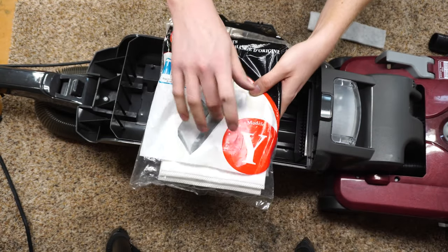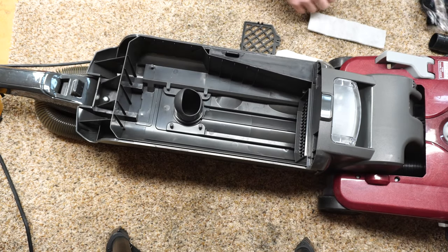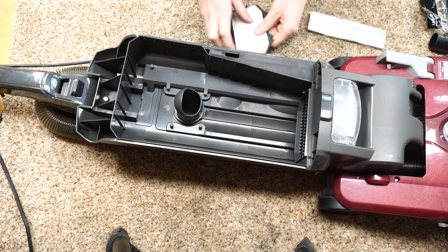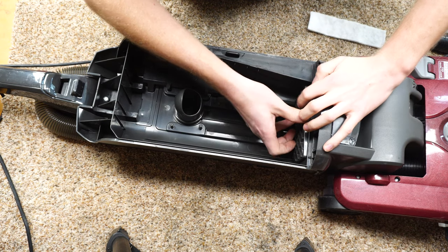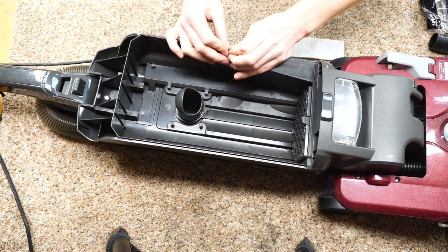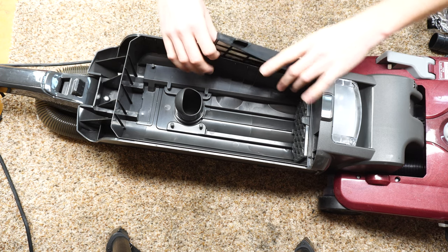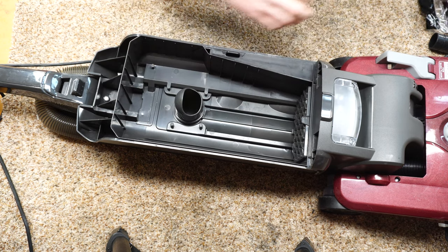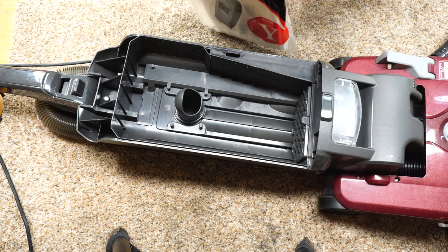And I'll put a link in the description to the proper vacuum bags. You want to make sure you use genuine bags. Do not use the replacements for this. They are quite bad. I'm going to put that filter in there. And then this filter on the side is not an allergen filter. It is to catch motor carbons, if you're wondering what its purpose is. And that's all it does. So really, all the filtration on this machine is done in the HEPA bag. So that's why I say it's important to get the genuine ones.